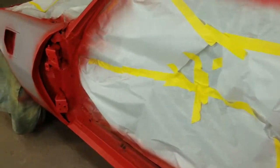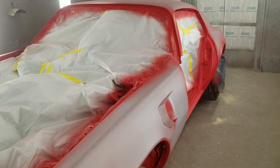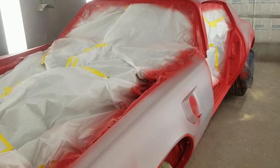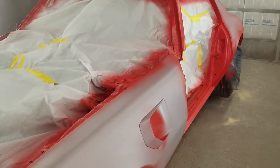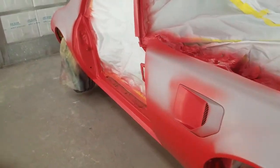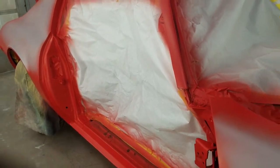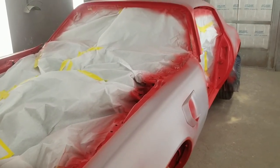Painting the parts off the car makes it a little difficult. This is Buccaneer Red, so it's a bit easier — the shade is going to be extremely close, if not dead on. But when you get into metallics, you want to spray the exact same way with the exact same shade sealer. You see so many show trucks and show cars where the panels are different shades — you want to try to eliminate that. The more consistent you are with your spraying and your sealer, the better off you'll be once you hang those panels.